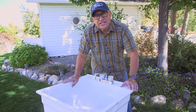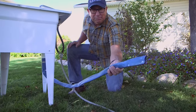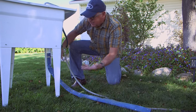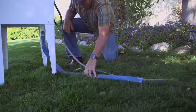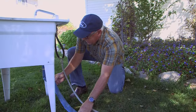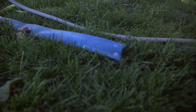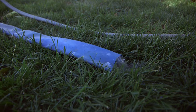The drainage system we have on this is a short piece of discharge tubing that's normally used for high-pressure pumps. This depends entirely on pressure being put into it, and it's a little problematic in this setting because the drain is gravity-fed only. Generally speaking, if I turn this on and adjust it, I can get water to come out okay, but the slightest kink — and it'll tend to develop kinks over time — results in backup, and you end up having to mess around with it to get it to drain correctly.